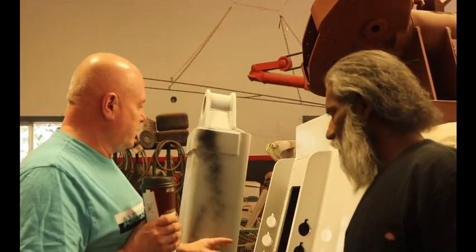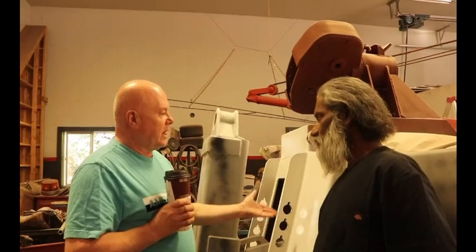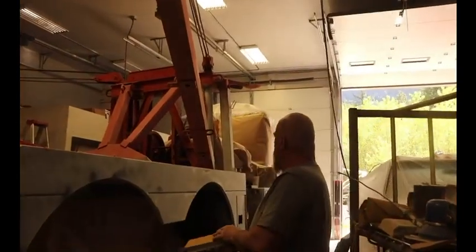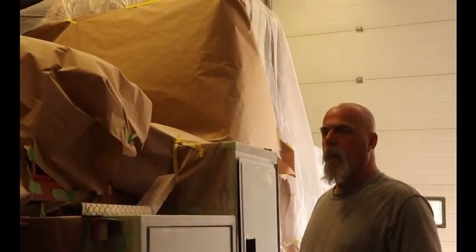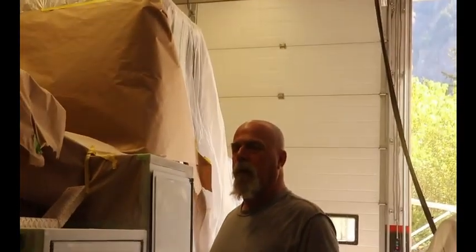What this is called is a Century HHU. It's basically not a really heavy duty underlift, but it'll tow highway tractors. It tilts down. Probably wasn't the best lift, but in the day it was all we could get for these trucks. So Rob, what are we doing on here right now? We are cutting the slick sand down to make it straight. As you can see, there are a couple of imperfections. So you put a thing called slick sand on there, which is a thick primer.